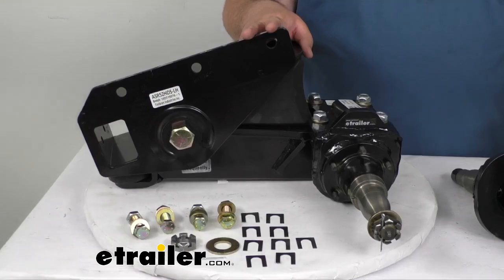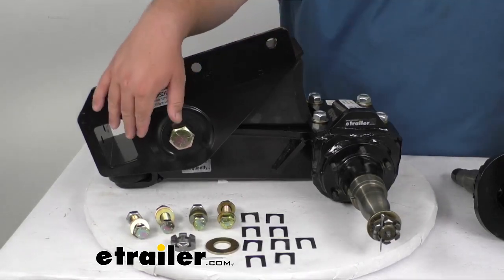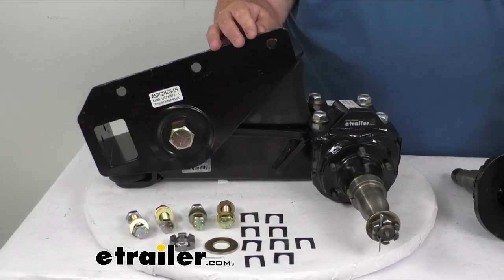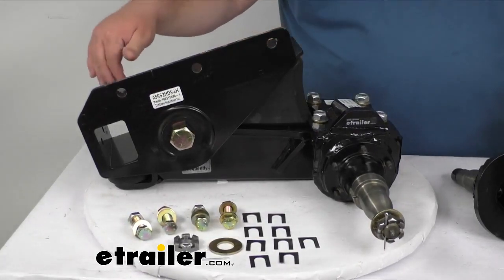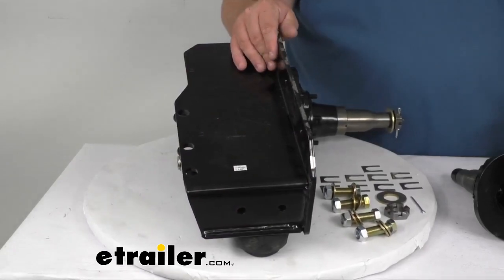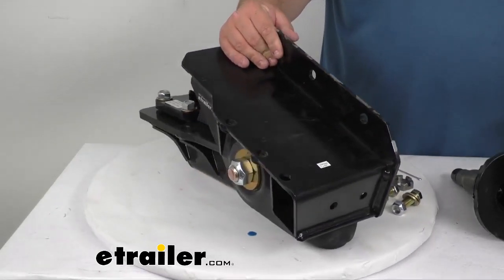First, you could retrofit your trailer with the cross member, simply weld something up in place. You can build out the trailer frame, again, weld, bolt on, whatever, or you can use a 2x3 tubing, slide it through this side, and then on the corresponding side across, and then connect the two systems together using a bolt with the built-in hole that's there as well on both units. So you've got bolt holes through the side there. That's how you would attach that if you don't have a welder. So pretty versatile as far as the options they give you there to mount this.